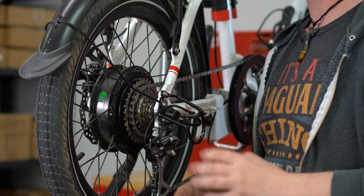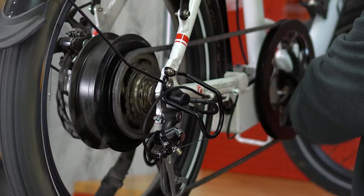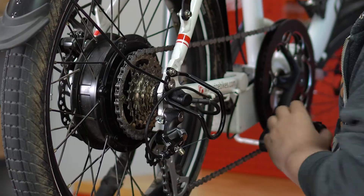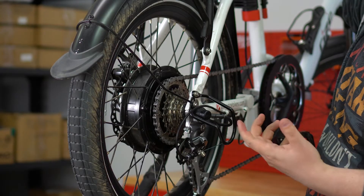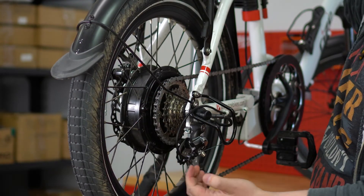This is a precision thing. You do have a range — it doesn't need to be perfect. Once you feel you've set that one, you will then continue again up to the next gears. If you feel that all the gears now are sounding correct, or at least smooth and light and not clunky, you'll eventually get up to the largest gear.